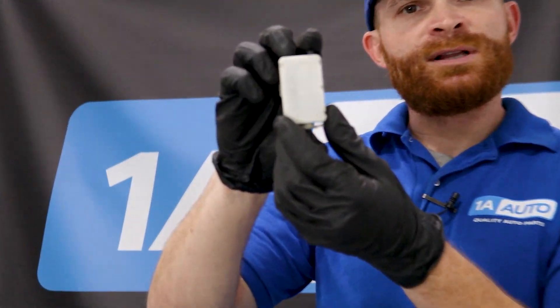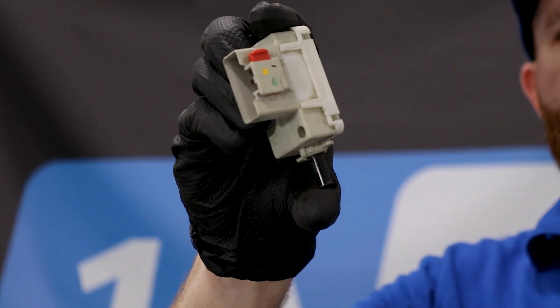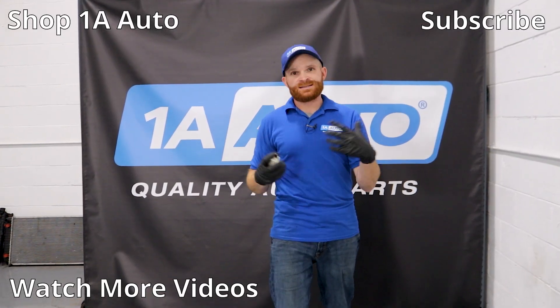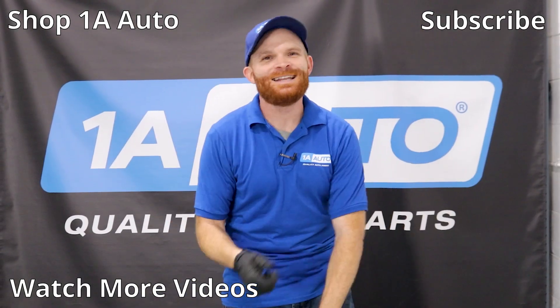If your brake lights aren't functioning properly, you're going to have an issue. Generally, the brake lights should turn on almost instantly after pressing on the brake, and the people behind you need to know when you're pressing on it. Go ahead and pull out your brake light switch, give it a quick peek, make sure it doesn't look burnt or cooked in any way, make sure the electrical connector looks in good condition, and double check that little piston — make sure it functions as it should. If you squeeze it and it gets stuck in the up position, you know that's an issue. That's what I got for you on brake light switches. If you liked the video, smash the like button, leave me a comment, and subscribe and ring the bell to be kept up with all of our latest content. Thanks.